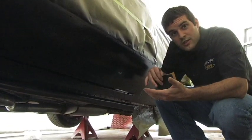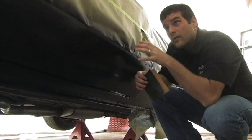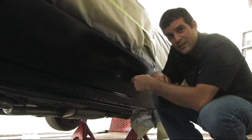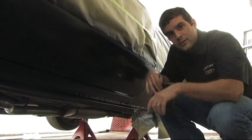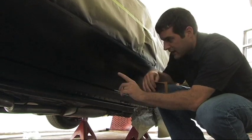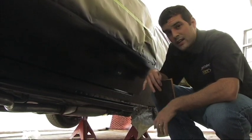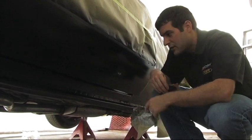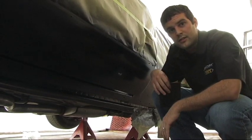We do have some tight quarters in our paint booth. Unfortunately when we were painting the door and opened it to get the door jamb, our pant leg hit the side of the car and messed up the paint job slightly. But the great thing about paint shop is we can come in here, sand it down — I used some 600 grit, feathered it out — give it a couple hours and paint it again. Brian's going to get the gun ready and pretty soon we're going to paint this again. You'll never even know it was here.